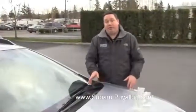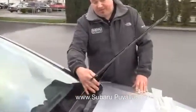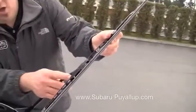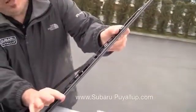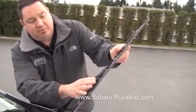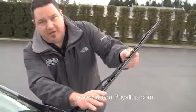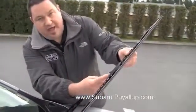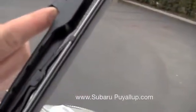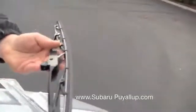It's real quick to replace your wiper blades and fairly simple. You just lift the arm up like this. They all have a little hinge here. You simply just turn the blade — this is actually the blade to replace. You can also just get the insert, but the quick, easy, and simplest way to do it yourself is just to replace the blade assembly. There's a little tab back behind here that you just put your finger on right there, and then you just gently press down on the blade and it simply comes off like that.